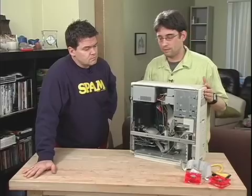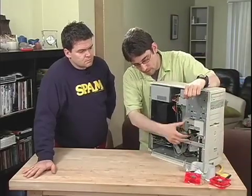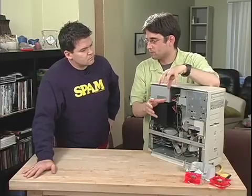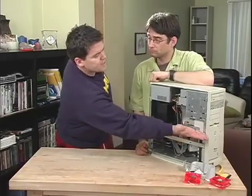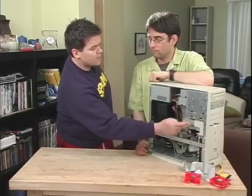Before we get into the whole issue of cables — a lot of times you'll see along the inside of your case you've got a space for your hard drives, and a lot of times you'll put them in right next to each other. If you have space to move them and space them out, do it. Because if they're right against each other, there's no place for the heat to dissipate. So you see here — there's a second slot for it there. If you have a third slot, keep the hard drives apart. Put them in one and three, not one and two. And if you've got a third one, you can put it in there, but it's not necessarily the wisest choice.